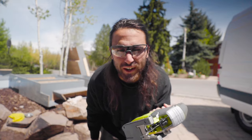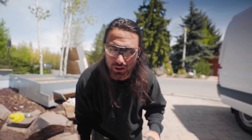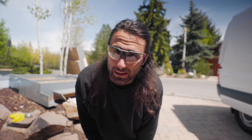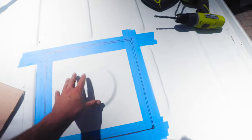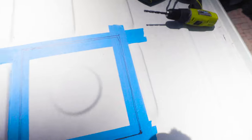It's only going to get more exciting because I'm about to cut a hole in the middle of my van. I made my template — I'm excited and scared all in one. To cut this hole you really need three things: a jigsaw (you could also use a sawzall or angle grinder, but the jigsaw is easiest), a drill to make your starter holes, and safety goggles. I've measured this literally about 20 times, remeasured, and used this template to find the right spot. There's a great spot right in the middle of the van where there are no ribs — especially since the kitchen's going under here — and I made sure it was centered off the ribs as best I could.